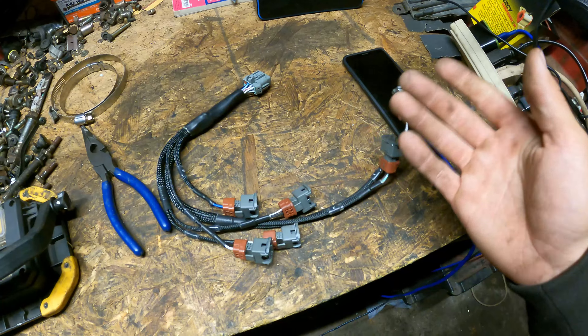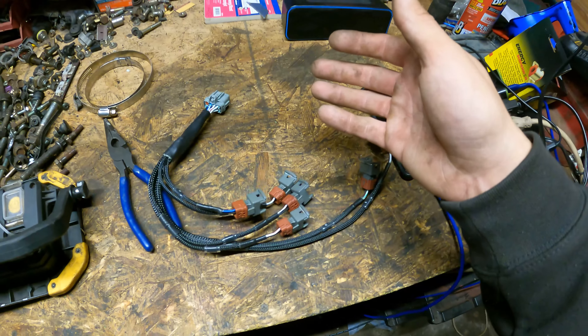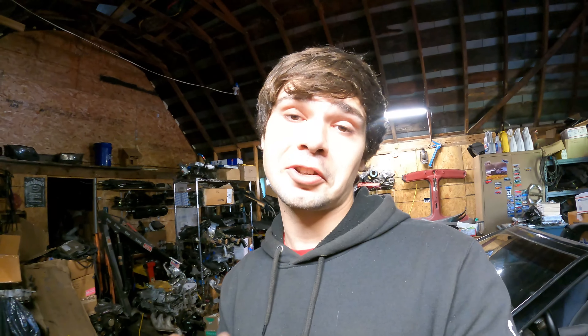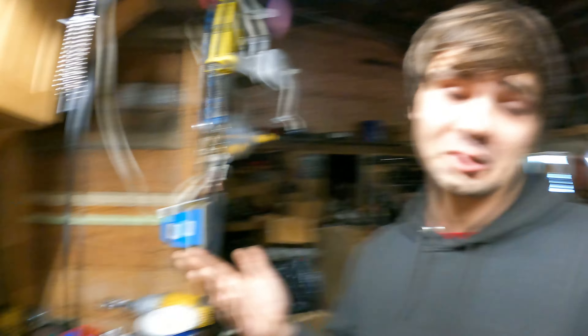However, the other injectors have the bright green minty freshness of death. Thankfully, I just bought a crazy deal on a 120K timing kit OEM — those things retail at like $700 right now; I paid $325 shipped. Also, I looked at a box last night and found that a Wiring Specialties injector harness side came in. That gives us six perfect brand-new connectors that we can crimp or solder on and bring this harness back to its former glory.